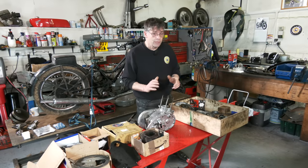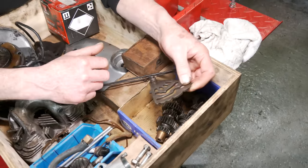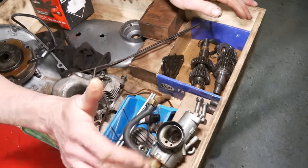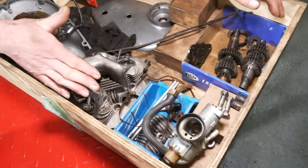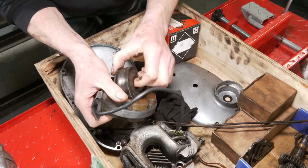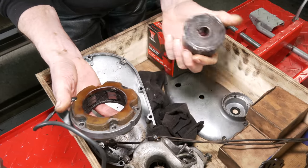The Tiger Cub engine — stripped out and actually not too bad. In this box we have the gearbox, or what's left of it: gear selector, main shaft, lay shaft, and our old favourite the sleeve gear. All this seems quite good. There's a carburetor — it's got a much bigger carb, a mod that was done. The cylinder head — we haven't taken the valves out yet. The alternator does look like it's cooked. You can see it's got very hot. There's been a dead short in the wiring — the alternator can only be replaced, otherwise we won't have any charging.